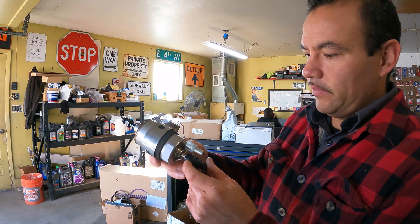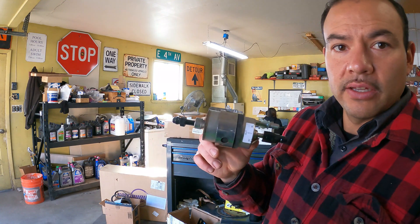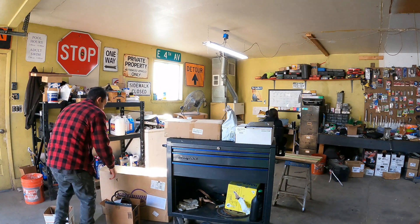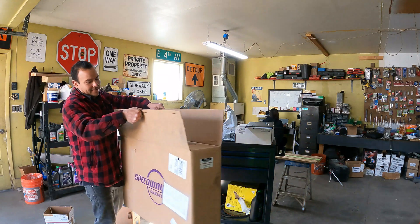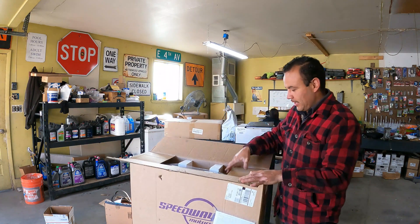I also have the Corvette filter and return line, all built into the same regulator. We also have our Speedway Motors radiator, and what I like about this one specifically is that it has both hose outlets on the same side — the passenger side — so we don't have to do a crazy crossover to the upper outlet on the driver's side. Just shorter routing for the radiator hoses, and hopefully it'll stay out of the way to make room for the electric fan and any other accessories.